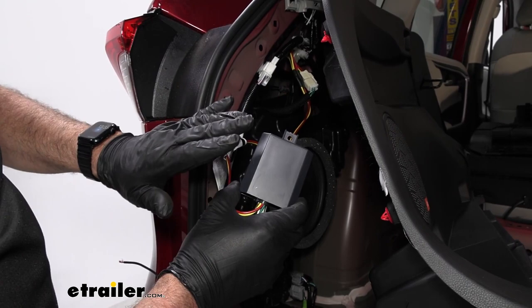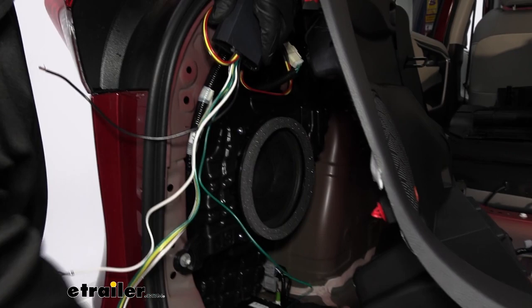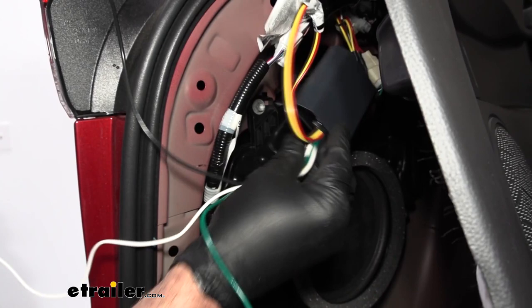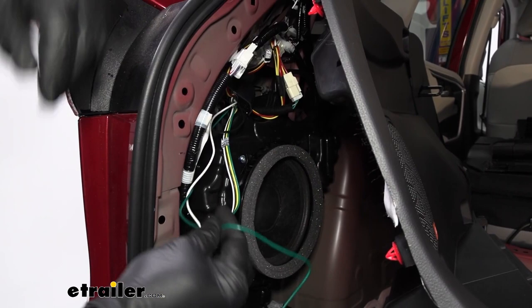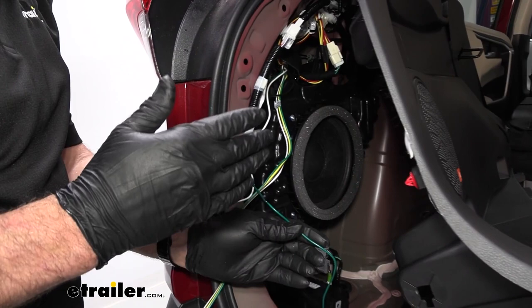When we have our driver's side connection hooked up, there needs to be a little bit of planning for where we're going to put the converter box, because we need to have a ground and we need to have power — the power is going to come later in the video when we run it up. There's plenty of wire for both. The ground we can use where the subwoofer is mounted to the frame — that's a perfectly good ground. I think we're going to end up mounting the box up here. We also need to make sure we have enough wire to run over to our passenger side, and I checked, and we do. I'm going to go ahead and mount this up above the subwoofer right now.